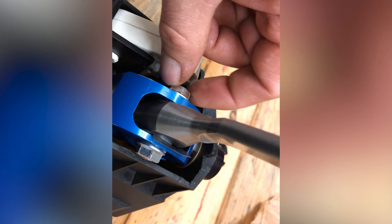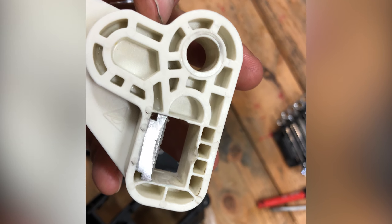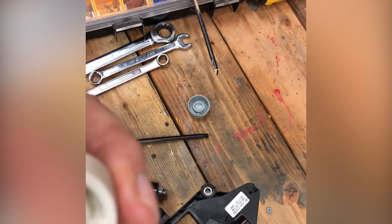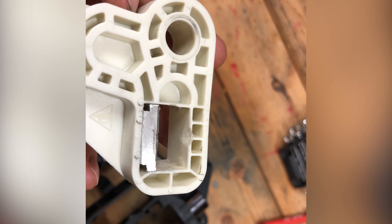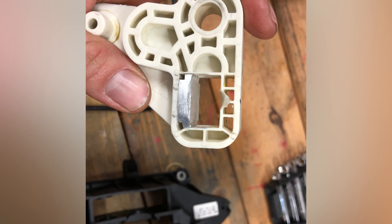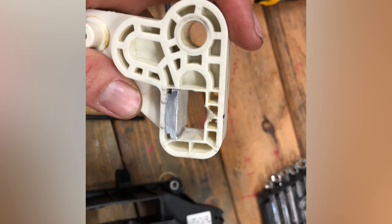My opinion on this B&M short shifter — I wouldn't buy it. The previous owner put this in so I didn't really have a choice, but after seeing the design and the pressure that ball can do and the damage it does on this piece, I certainly wouldn't buy it again. I've also been working on the slop from top to bottom — got that adjusted out, nice and perfect. The other slop I showed earlier — the stick going back and forth — I've got a three-thousandths shim in there just testing it out. You get a little by tightening the nuts but not very much; that shim really makes it nice and perfect with no slop.